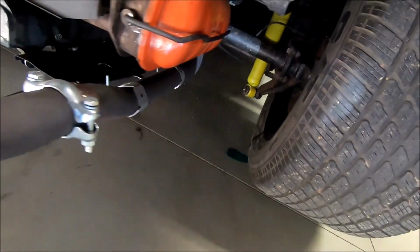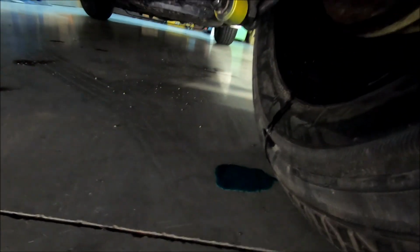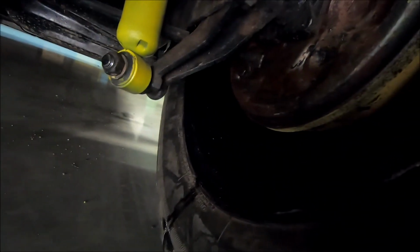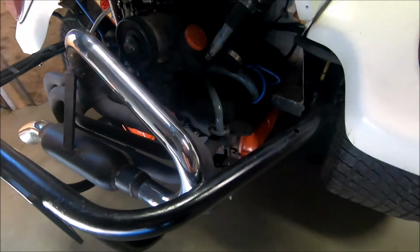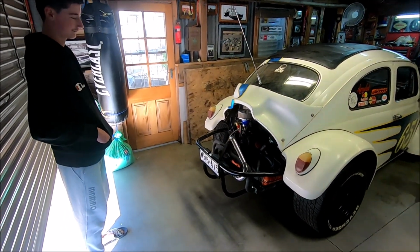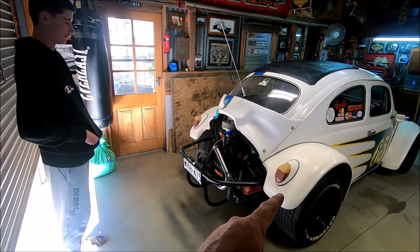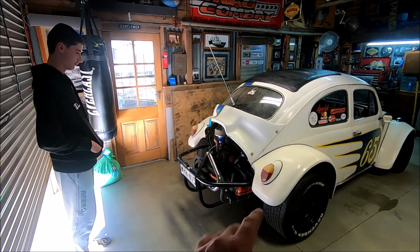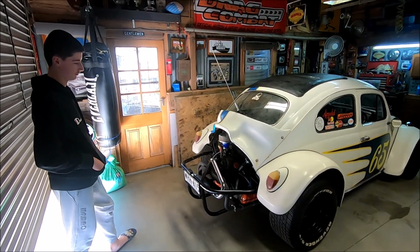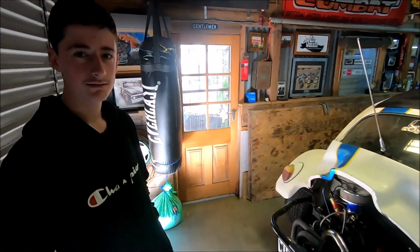Are you joking me? Oh, that's the wheel cylinder. Ah, bloody hell. That means we've got to pull the back wheels off. Well, actually, that probably explains why it was still pulling to the left-hand side, because if that's not working and it's squirting oil out, the other ones are, it drags it over. Yeah. Ah, the journey continues.